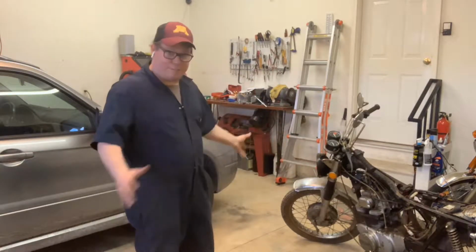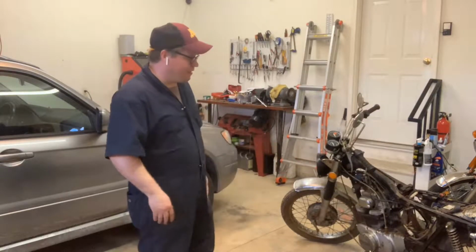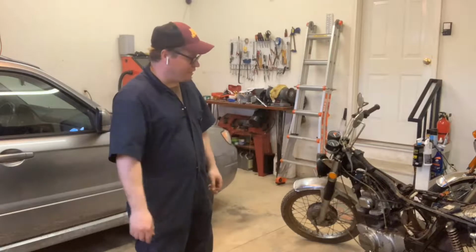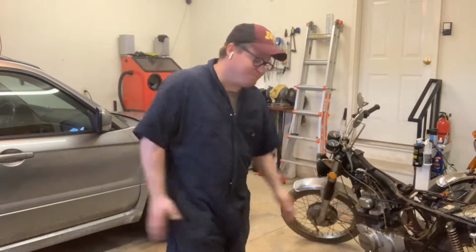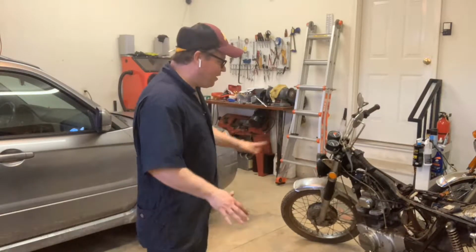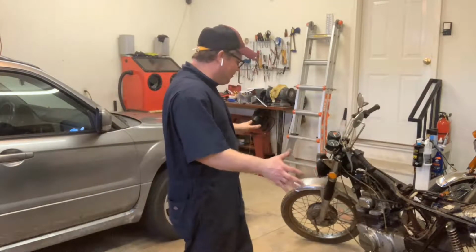It was going to come out in the first place, but because I had that little spark plug debacle, a bunch of stuff went down in the cylinders when I was pounding those out. So there's debris in the cylinders. So even if I wanted to get it running, that's a major, major problem. But again, I bought the bike for $100, so it's all good.